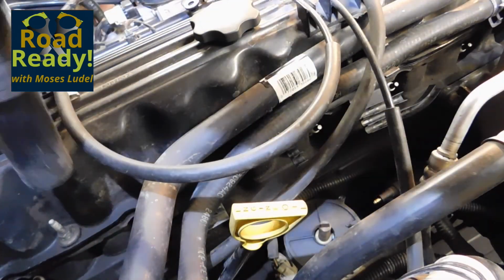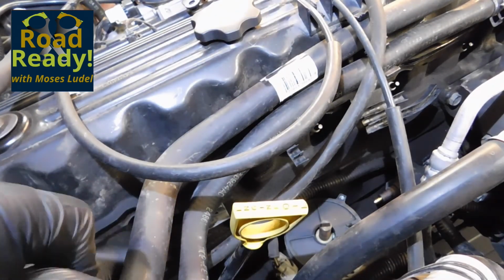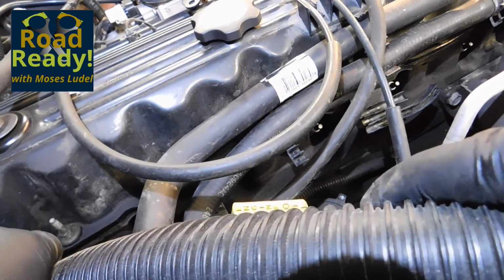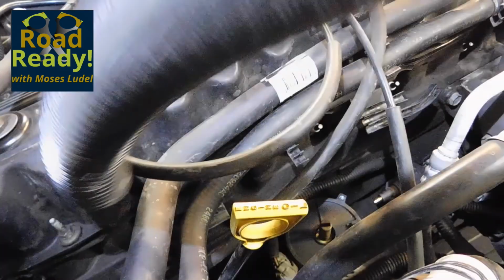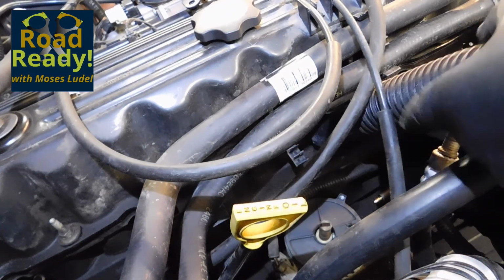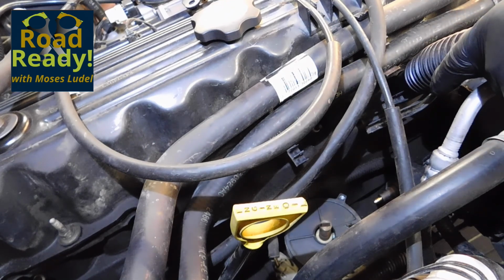If necessary, use a pressure washer or go to the car wash and, with a cold engine, clean the area around the spark plugs. This is best done at your shop or home garage with a pressure washer. The engine must be cold when you perform that task. Never pressure wash a hot engine. You can crack iron castings by spraying colder water onto a hot engine casting.